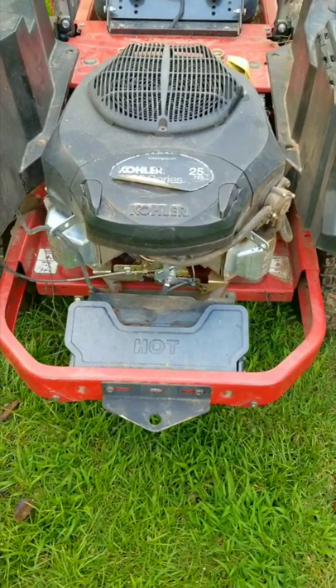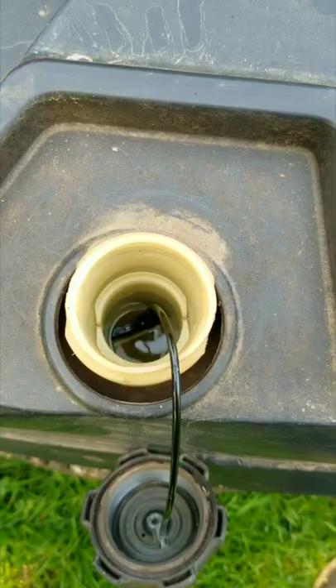I'm working on a zero-turn mower that was starting and now it's not. Turns out someone put gasoline in the tank that unfortunately had some water in it, so now we need to get it out of the fuel system. The problem is getting it out of the system is the hard part. I did siphon all the bad gasoline out of the tank and the fuel lines, but there's still some of it in the carb's bowl.